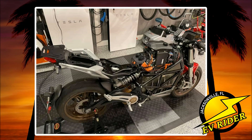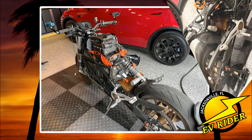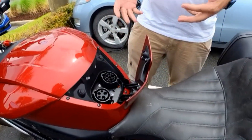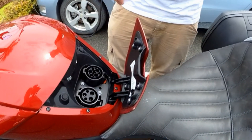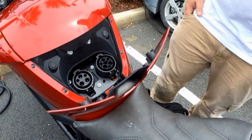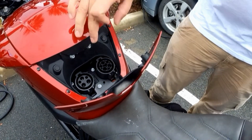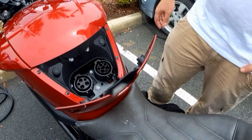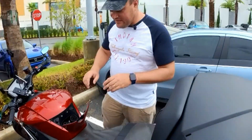Scott designed the system to be installed at the same time as Zero's optional Rapid Charger by either the rider or a Zero technician. You just open your stock Zero charge port, and rather than having one connector, you have two. He designed a bracket that replaces the stock OEM bracket from Zero so both connectors fit. This is the same connector that comes with the Rapid Charge kit — they call it the 12 kilowatt harness — and the one that comes with the bike stock is the 9 kilowatt harness. Those two together are able to do the job, and there are no switches or anything — it's just automatic.